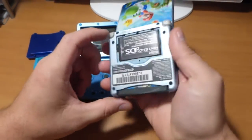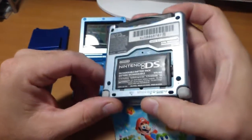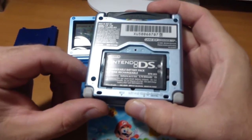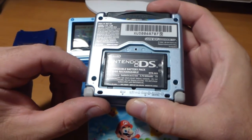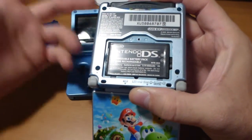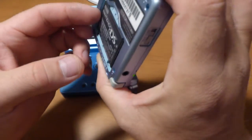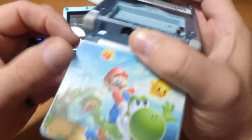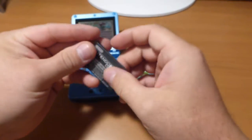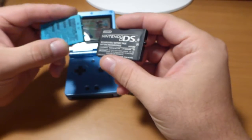What I've come up with — if I flip it you'll see — it's a Nintendo DS battery. Not from the DS Lite, DSi, or 3DS; it's from the original fat DS, the first generation. Let me pull out the battery and show you what modification needs to be done to make the battery fit in your Advance.